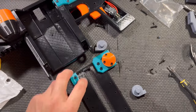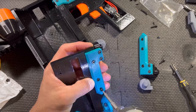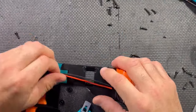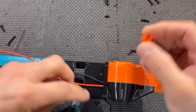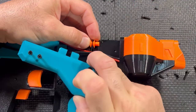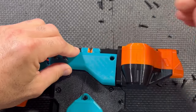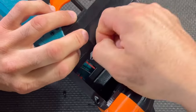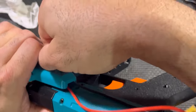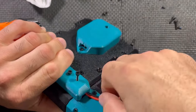Now attach the door. Before doing so, take advantage of having something to hold your bungee cord on the other side and run the pulley system. Go around with the pulley, tuck it into the ammo compartment as shown, and seat the pulley on the pulley seat. Get the pulley cover and cable management cover and put it over this area — it takes a little finger pressure but this is the only clean way to do it. Make sure the little piece is accessible from the side, cables are not pinched, and put an M6 screw here. Position the screws as spacers so cables can be tucked around them rather than pinched under them.